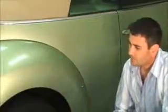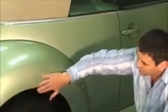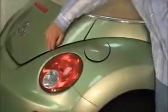As I'm sure you're aware, the initial prep of the vehicle is extremely important to a successful vehicle wrap. We have to pay close attention to how we clean wheel wells, around gas caps, even opening trunk areas and doors, making sure that we clean all the areas that we might be tucking the vinyl, places that we might be trying to place the vinyl that are hard to get at. Make sure that everything is as clean as you can.